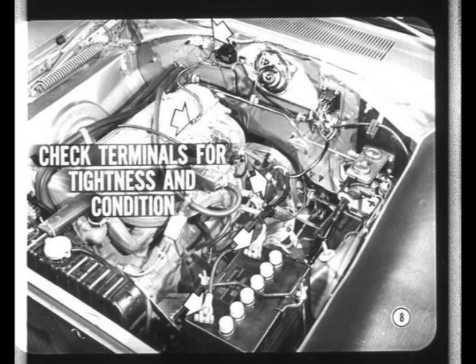Now, if the battery appears to be in good condition, check both battery cables and the body ground cable from the engine to the bulkhead. Also make sure the bulkhead connector is pushed in all the way and that all charging system wiring and connections are in good condition.